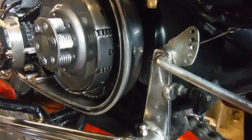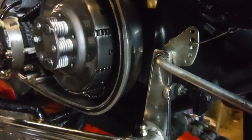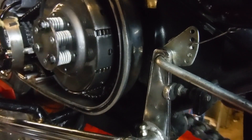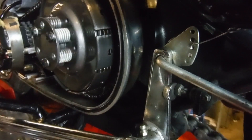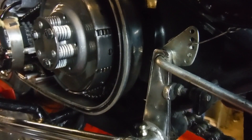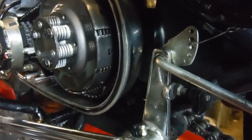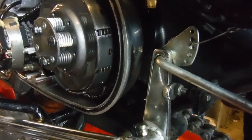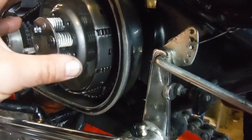I've got to address that first of all, so I'll be taking all the springs out and taking the pressure plate off. I'll go through the friction and plain plates as well and check that they're serviceable and true. I'll probably do my modification to the end of the clutch push rod if it's one that's shaped like a sort of inlet or exhaust valve and round it off. That portion of the pressure plate is lifting there, but over here it's barely lifting at all — so that is causing drag.